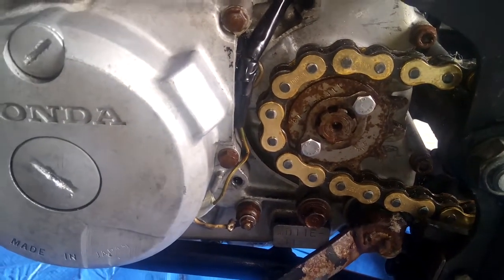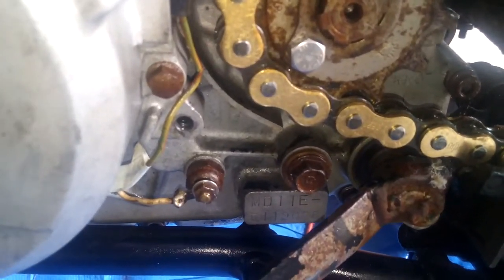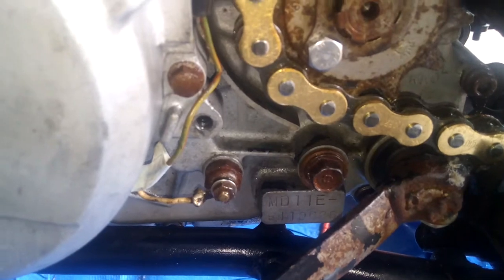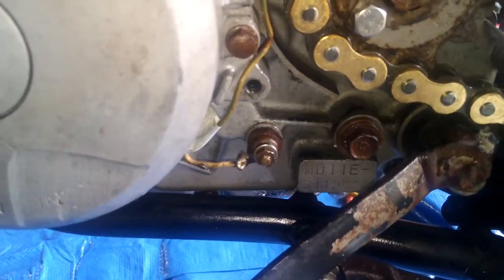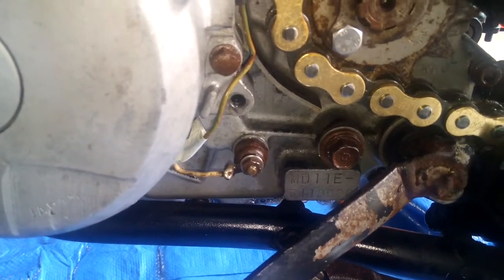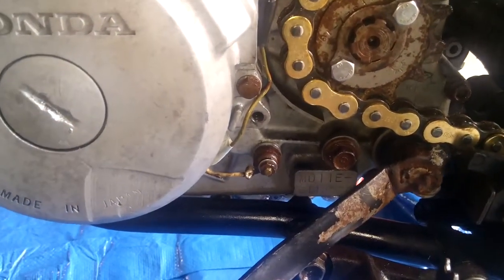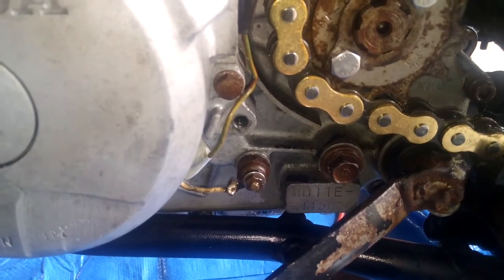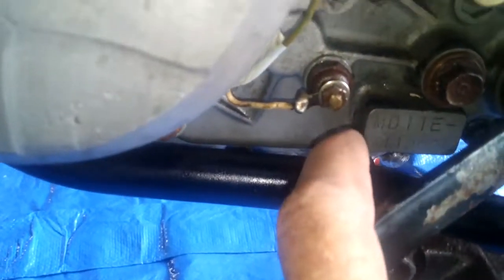In my ignorance — and I do know quite a bit about these engines — I've learned a very serious lesson. To drain the oil out of this engine and put in a new filter and have it all nice and set for riding, I withdrew this bolt. This is about a 2-inch bolt with a taper on it, and it sits nicely through the fork ends of the spring on the spindle of the gear shift lever. When I pulled the bolt out, the spring sprung off the back of a little tab on the selector plate and dropped down around about there.